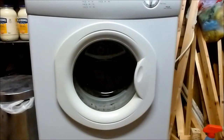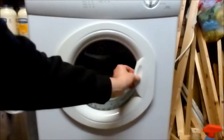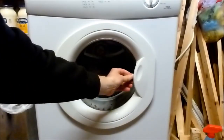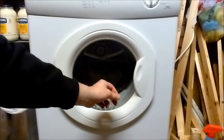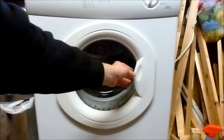Today we're going to fix a problem that happens with a lot of old Hotpoint tumble dryers where the door catch spring breaks. So you close the door and try to start it but nothing happens. You can usually push the switch forward to make it start, but it gets to be a pain, so the best thing to do is to replace the whole switch assembly.